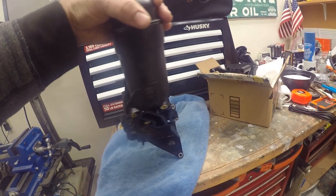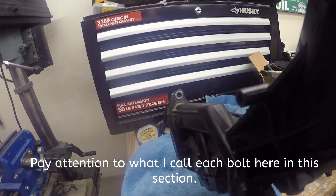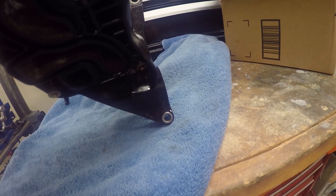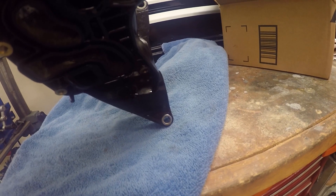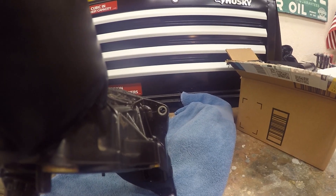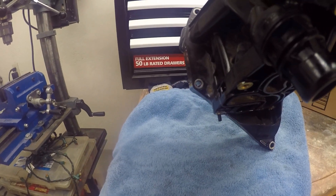Here's a lesson learned when you're taking this thing out. You've got one, two, three, four bolts. Number four you really can't see — it's blind, hidden behind the heat exchanger. Number three you can see but it's hidden by wires. It's tempting to take the two visible ones off first, but when you do, this thing tilts and then there's not much room to get to that bolt. If it's straight as opposed to leaning, you can get the wrench on there better. Strong recommendation: go number four first, then three, which are the two hardest ones — number three is the toughest — then go to two, then one.